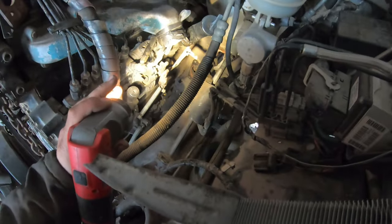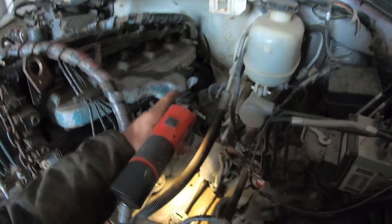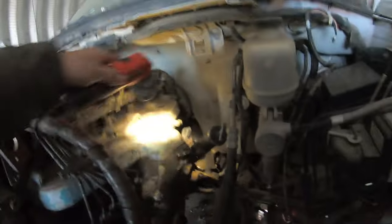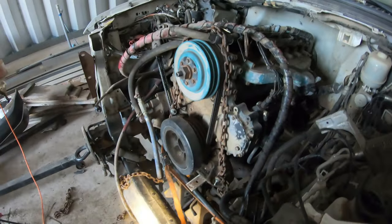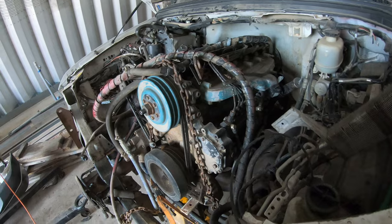I haven't looked at it enough — the back of it really looks like a pump, but that's the governor. There's that air nipple right there, and that air nipple feeds into the back where there's a diaphragm. That controls how much fuel is going into it when you're stepping on it. It's like a boost sensor without all the electronics, which is pretty cool.